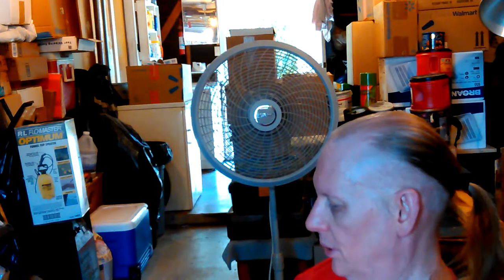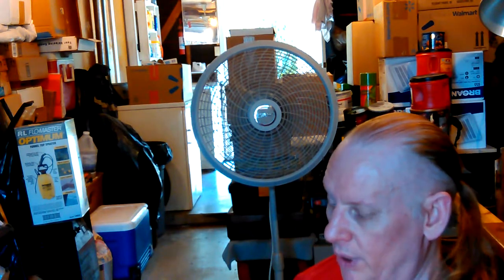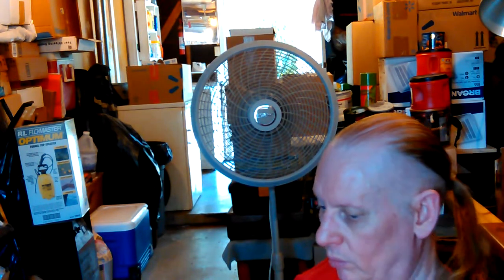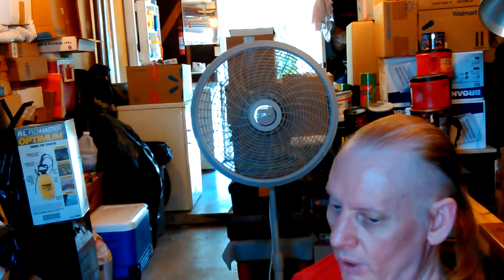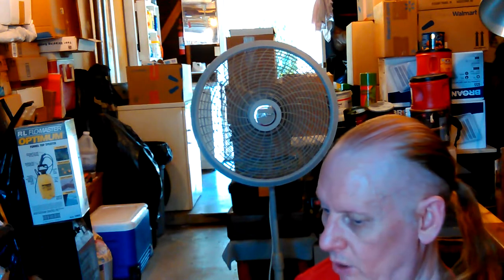There's something really wrong in there. I think it's more than just clogged up holes. I don't know, maybe that goop in that hole was causing the vacuum to be all wrong and causing that. Because, you know, I do know they work. They're not just a pump. The only pump in it is the accelerator pump. It's a little diaphragm pump. The rest is vacuum pulling the fuel.